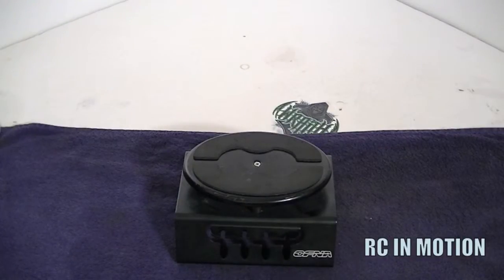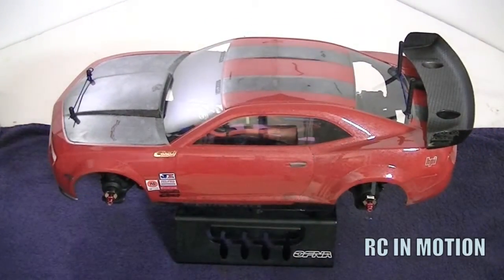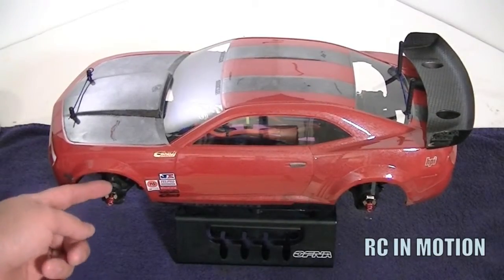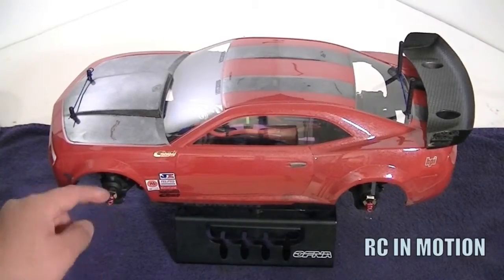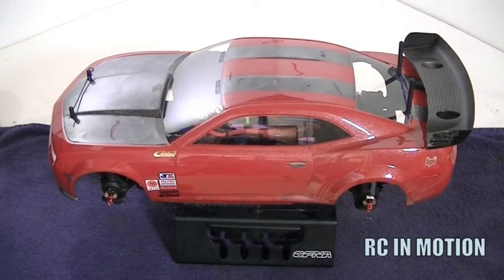Let me show you what I've been up to. This is my first one — I have a lineup of about four or five to finish. I call this one the Frankenstein, and you'll find out why in a minute. This is a Red Cat Racing EPX Lightning, or ESP Lightning — something like that. It's totally changed: I've installed parts from other vehicles, like aluminum hex with a grub screw from my Trail Finder 2 kit. The plastic ones were binding and the wheels weren't spinning properly on the bearing, so I put on these metal ones so they drive freely.